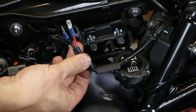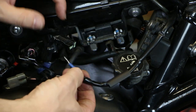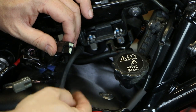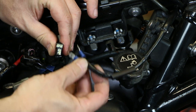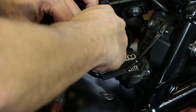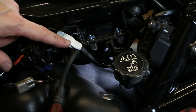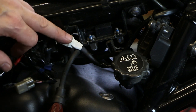In the kit you get a little bag with connectors. I've crimped spade connectors onto the ends of the cables and added a little heat shrink for neatness. Once you've taken the shrink wrap off the accessory plug, it's just a case of plugging the spades in. I didn't have heat shrink big enough to cover the whole plug, so I've pushed the heat shrink up over the spades, then wrapped a little bit of electrical tape around to protect it. In terms of polarity, the vertical slot takes the red cable and the horizontal slot takes the black.